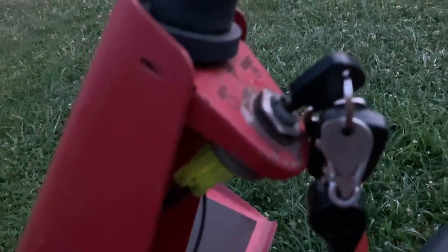Those 4-gauge cables from Walmart are only four dollars, so they're cheap. I saved the ignition switch from the wiring harness the guy gave me when I bought the mower. I took the switch out of that wiring harness, put it up here, and also kept the solenoid from it. You need four wires going to your ignition. I put insulated end connectors — yellow ones for number 12 gauge — on there. Use insulated connectors so none of the wires touch and cause a spark.